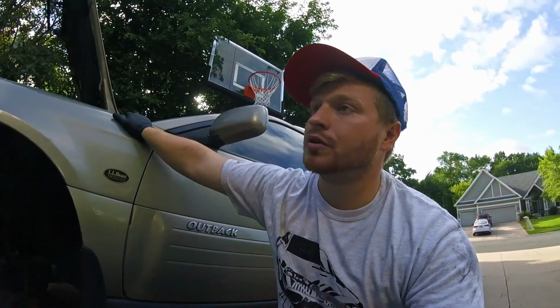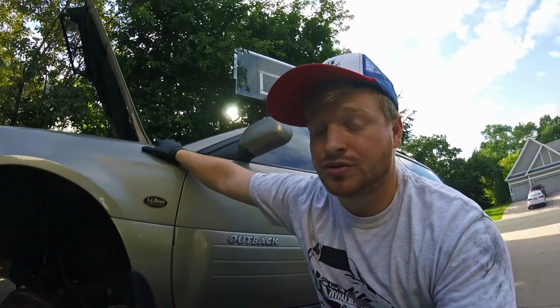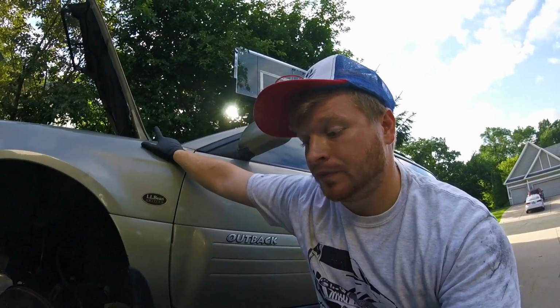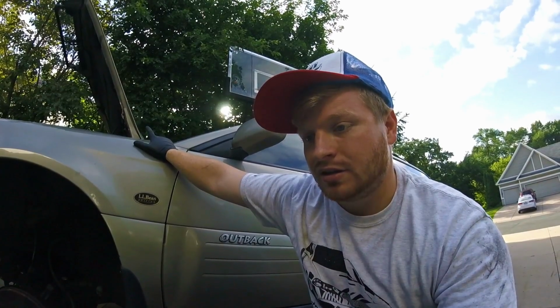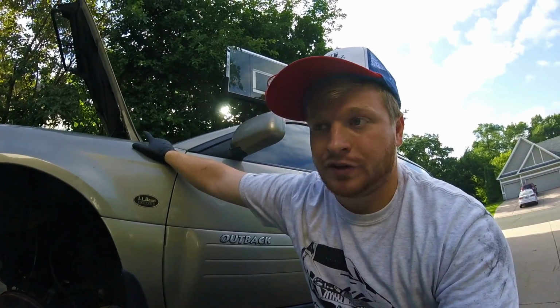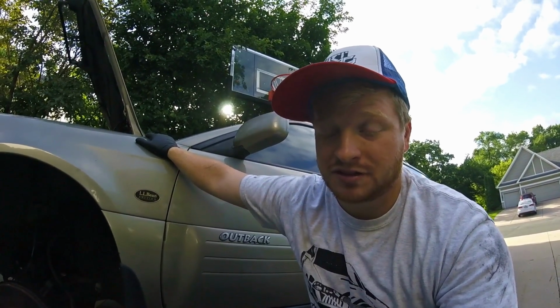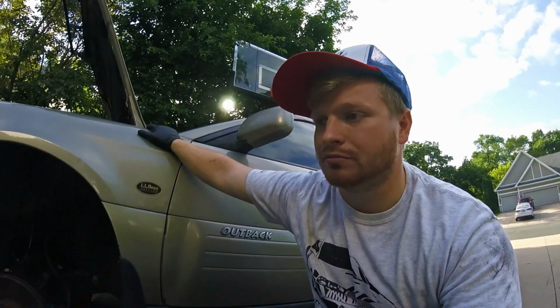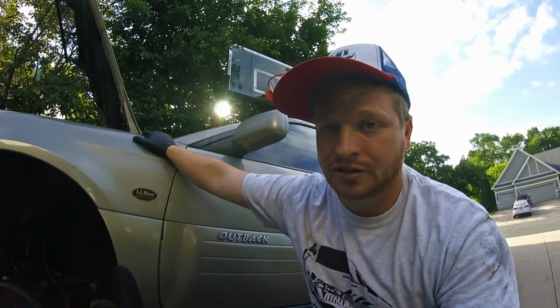One more input on coilovers that I will pass along from Rob Carlson, a Pro 2 drift driver. He said, only buy coilovers if you're going to use the adjustments. If you're not going to adjust them, just buy Megans, because they're all the same if you're not going to use the adjustments. So if you're building a race car and you want camber and caster adjustments, buy some good 3-ways. Otherwise, if you're just looking to get low, buy lowering springs, not coilovers, because you'll just be miserable, and there's a good chance you'll try and trade them in about 6 months.